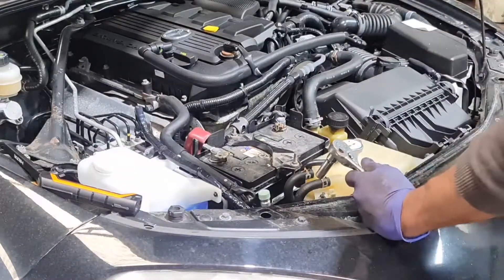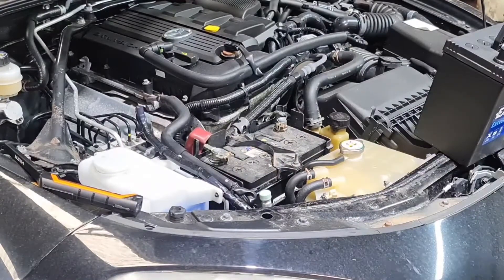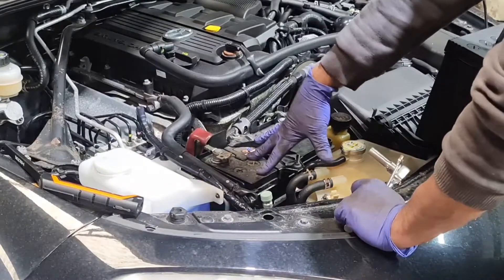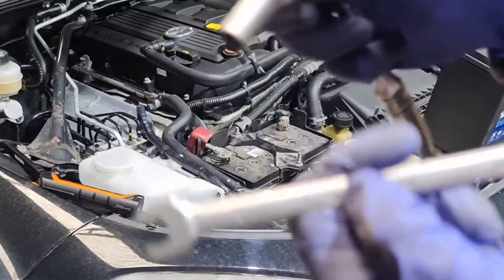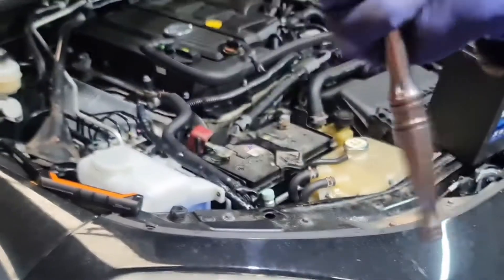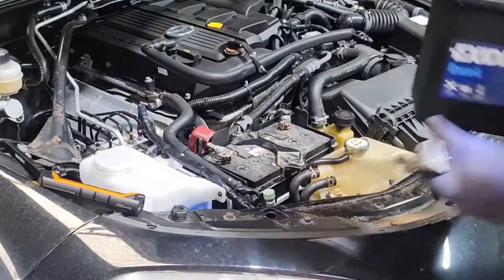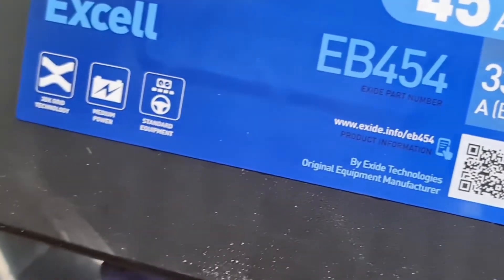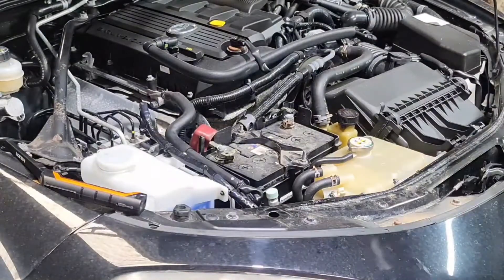Hello from Targen Medics. I've got a Mazda 5 here on a 2010 plate, just replacing the battery. This is basically what we're replacing. What you need is a 10mm spanner, and a 10mm socket and ratchet if you've got them. The battery part number is right here - that's what you want to search for if you need one urgently.